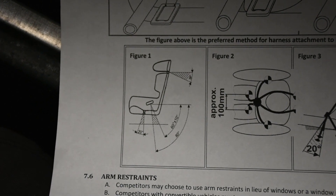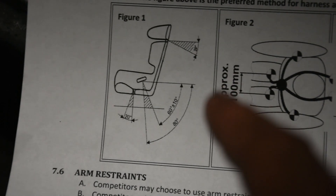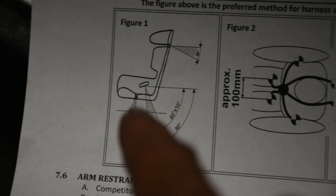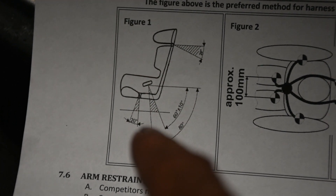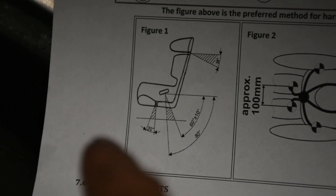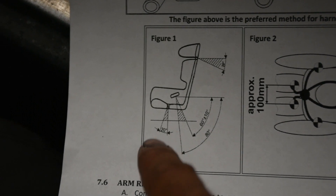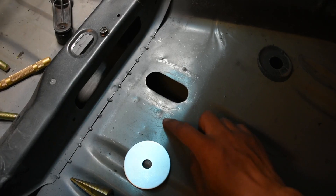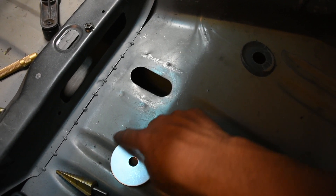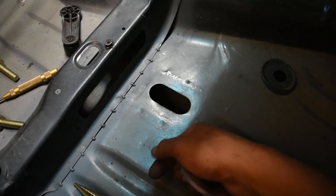Just like with the shoulder strap, you're going to refer to whatever racing organization you're building your car to compete in and follow the instructions on what angle to mount your harness at. For Formula Drift specifications, I have basically zero degrees to a positive 20 degrees — so 20 degrees forward in front of the hole. Before I drill the hole in the chassis, I'm going to make sure my markings fall within that zero-to-20-degree range. I've determined my harness needs to attach somewhere along the spot weld line, and I can figure out where the clear path is to drill the hole and mount the eye bolt.